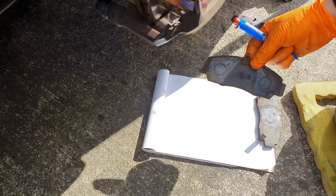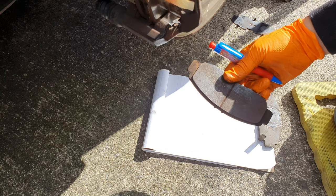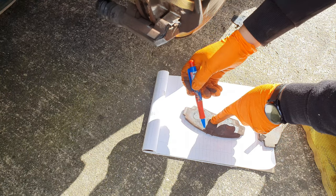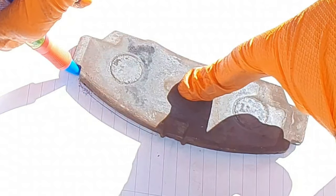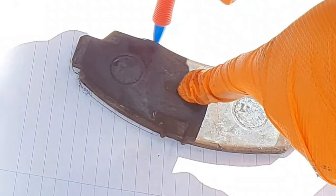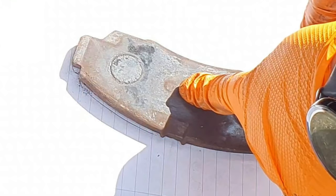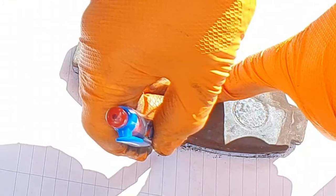Another little trick I do normally: if I don't have a part number for my brake pads - especially with Japanese cars, it's very hard to get the right part number - what I'll normally do is just take out the pad from the car itself, put it on a piece of paper, get your spider-man pen, and trace around it including every little lump.